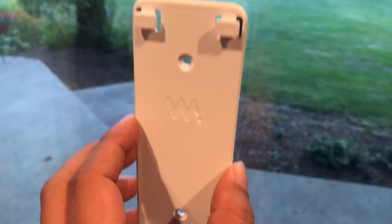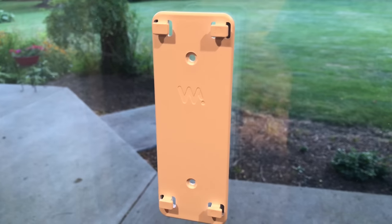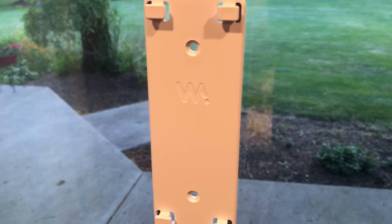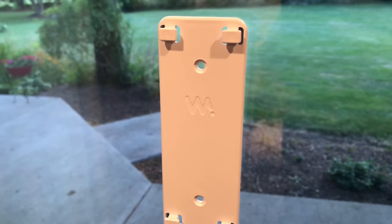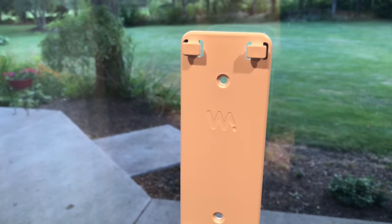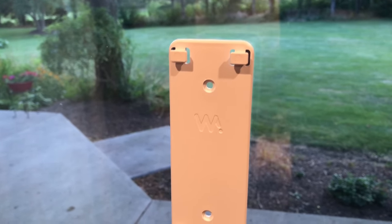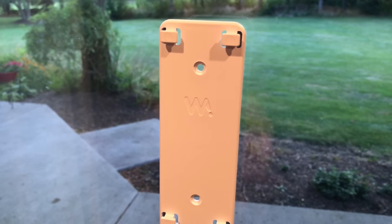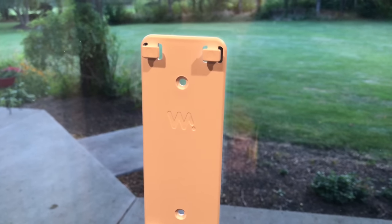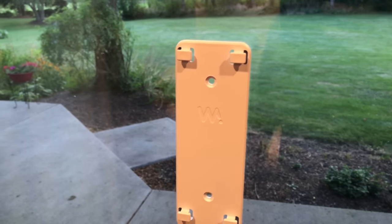I took the backing off the back plate and I'm just going to put it on the glass. There is an app to kind of locate the best place to put your antenna. The key is you want to stick it on glass that's facing the direction of wherever the TV broadcast antenna towers are. In my case, they're coming from the south towards the city of Chicago. If you can point it in the direction of where the TV antennas are, great. I'll also say that might be on the second floor of your house. The other thing is that you actually connect this to your Wi-Fi router, so you want to have it — apparently on their website they say — within 20 feet if possible, line of sight of the Wi-Fi router. My router is just over here, so I'm definitely within 20 feet but not right on top of it.